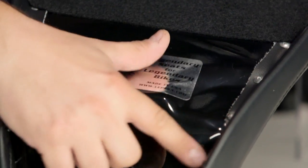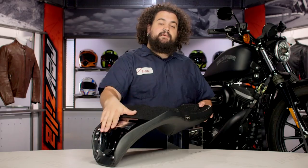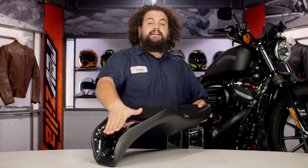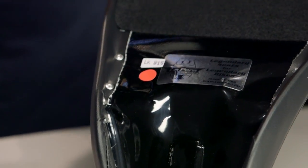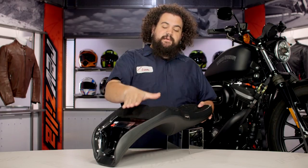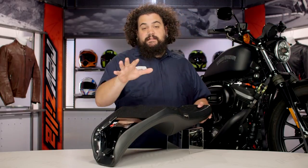You can see here they do rivet down the cover — it's a great way of keeping the cover in place, very secure. And because those rivets are aluminum, they're not susceptible to rust. The base plate is a 16 gauge steel pan like most LaPera seats. I love their steel pans — they are super durable and sturdy. They do not give up over time like your OEM plastic does. This pan will be good for the life of the seat and it is going to bear your weight.